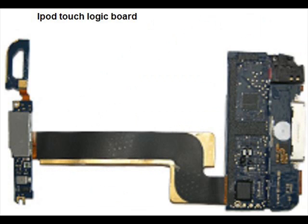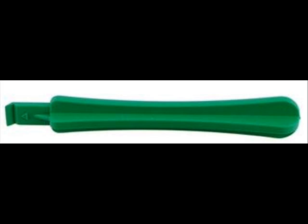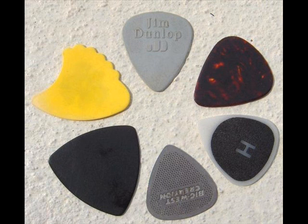So the trick is you've got to get the water out. To do that, you have to open up the iPod. Some iPods open differently and it's really not that difficult if you just follow the instructions. For the iPod Classic, they usually give you a couple of tools, like I'm showing on the screen here. Or you can use a guitar pick and just run it across the seams of the iPod between the chrome backing and the top, and that will open it up. I have a video on how to replace a battery on an iPod Classic that'll show you how to open it.